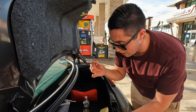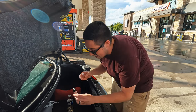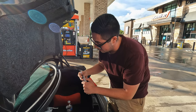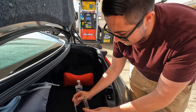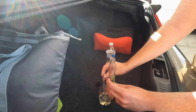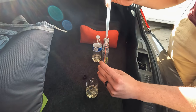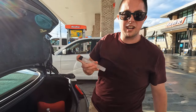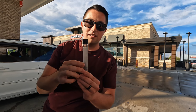Back at the test kit — we've got our little droppers, or as Megan called them, pipettes. We already have the water filled to the line. All we're gonna do is squeeze some of the E85 up into the tube — without dripping it everywhere, hopefully — and fill it up to the desired line. Then we put the cap on, shake it up, and set this on a level surface. We'll let this all separate out and come back in just a moment.